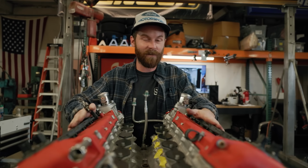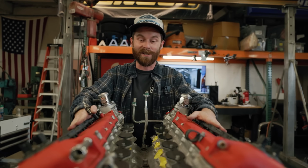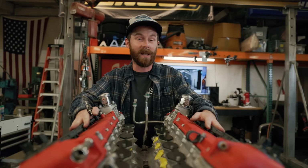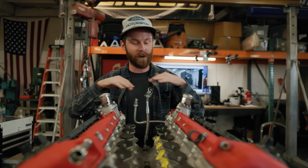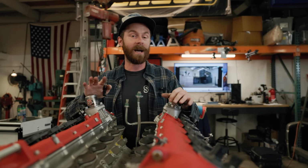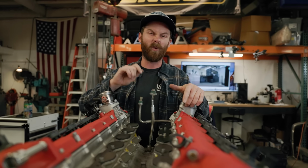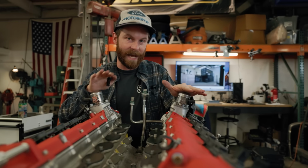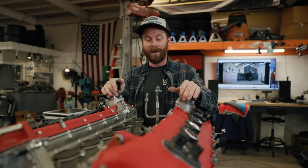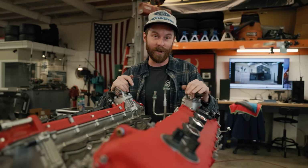And then the Enzo engine, if I remember right, is 11-to-1 compression versus this 13.5-to-1 compression. That's a huge jump. There's going to be a lot of power on the table there. Plus, we're going to have different cam timing and advancements. The head's going to flow better, all that kind of stuff. I think port injection will make within 1 or 2% of the exact same power before we start tuning this thing and pulling power out of that side of the equation and making more.